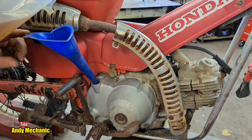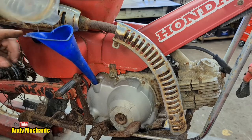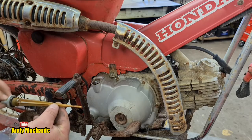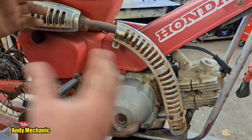No idea how much is needed to get back on the dipstick — it's completely off the dipstick, which might indicate she's a bit of an oil burner. We're about two millimetres from the top — that will do just fine. The engine isn't seized up. It was critically low on engine oil — we put about half a litre in to get it back into the hatching area on the dipstick. These things probably only hold just over a litre. That might indicate the engine burns oil, the rings are badly worn, or the valve stem oil seals have failed.